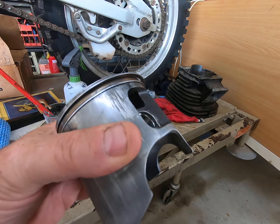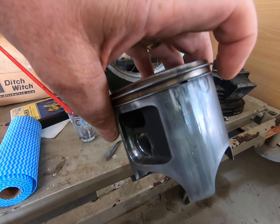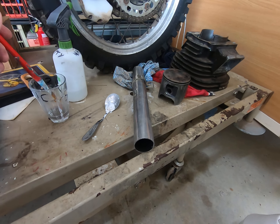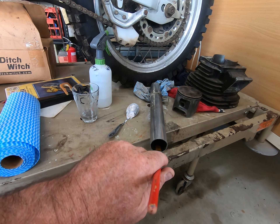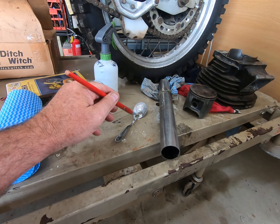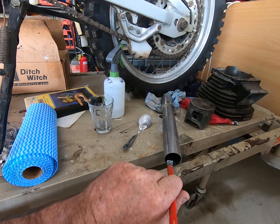I'm going to demonstrate how it works. When you look at your piston you'll see all those line marks, and if you look down your barrel you'll see corresponding raised lines — that's the aluminium that's stuck inside your cylinder and that's what you've got to get rid of. We start with the wet mix of the hydrochloric acid — I'm just going to use this bit of pipe as an example — and we paint it on to where we know the aluminium is.